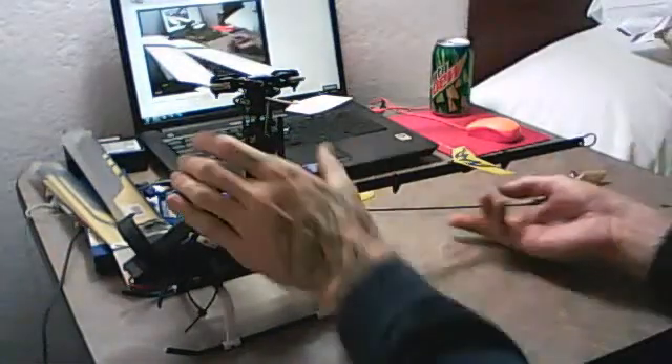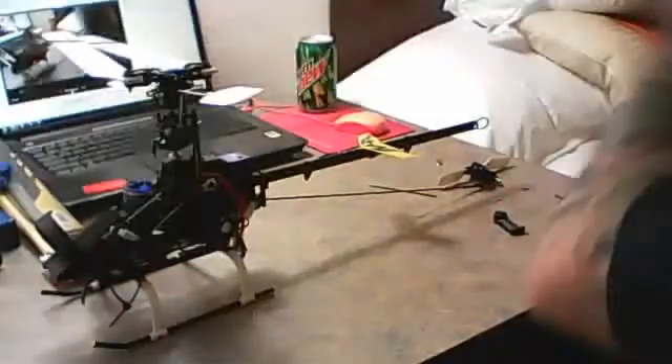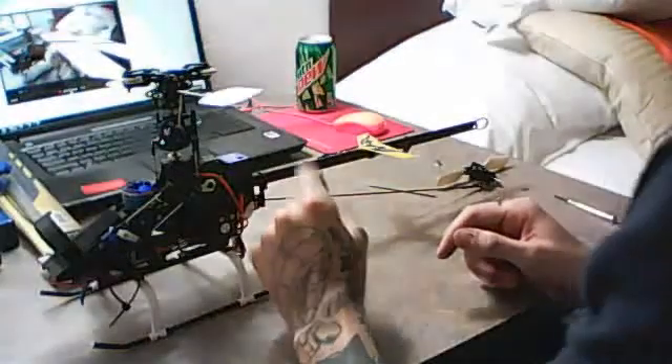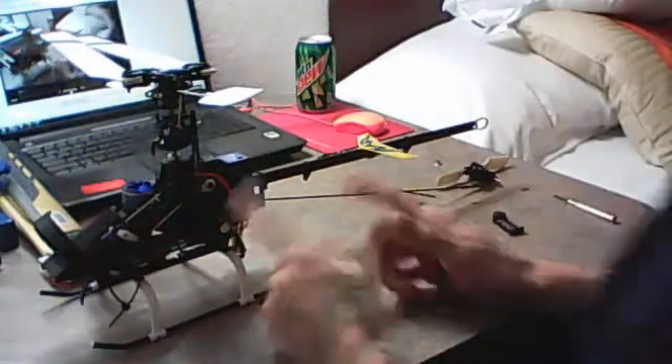I've taken the back off. I don't want to mess it up by moving it around too much, but the belt itself is really worn down — it's not really teeth anymore, it's more of a smooth rounded bubble tip. I've seen another video on YouTube where the guy was having the same clicking problem, so I'm going to try and change the belt.